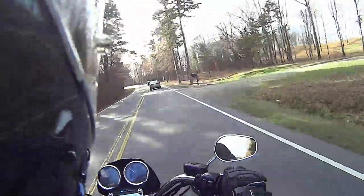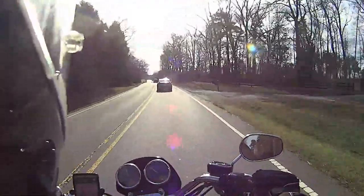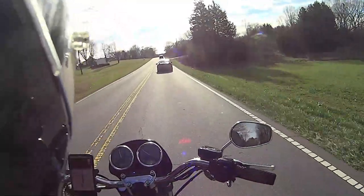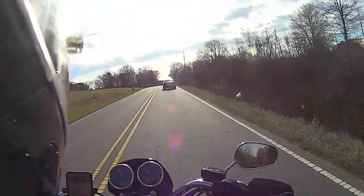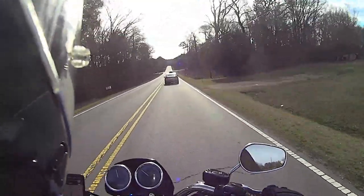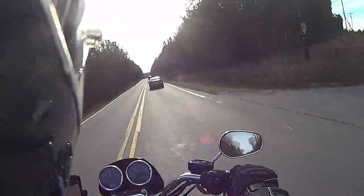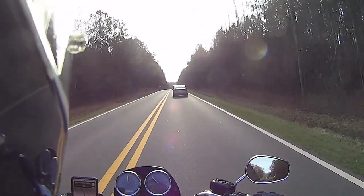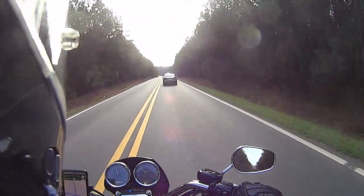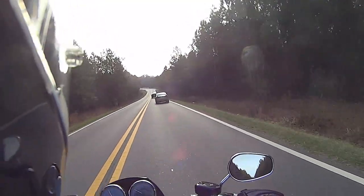I've thrown this bike into corners at 85, 90, 100 and it's fine, but it's a little all over the place. I have the steering dampener now and I think better suspension would absolutely help cornering, but you still have a rubber-mounted motor on a frame that's not as stiff as an FXR — so there are compromises. If I were building a really high-horsepower Sportster — Hammer has 120 to 130 horsepower 1275 kits — I'd maybe consider a Dyna frame with a slightly extended swingarm to get the wheelbase where it needs to be.